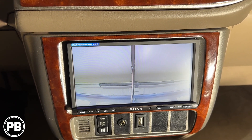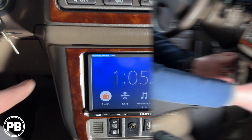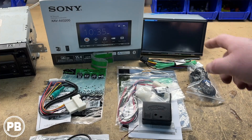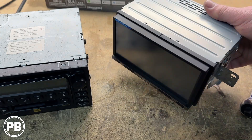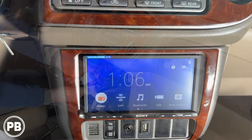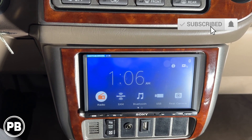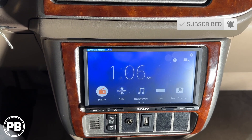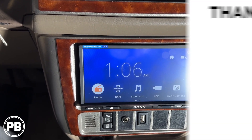The biggest reason why we wired it the way we did is we can click on camera and pull the camera image up without having to go in reverse, because we're powering the camera off of accessory. If you want to see how we installed this radio, we'll link that in the description — that video walks you through step by step on how to install this aftermarket unit in the factory location. Thanks for watching. Hit the like button if you liked what you saw and don't forget to subscribe. We post great content on the channel all the time and we'll see you in the next video.